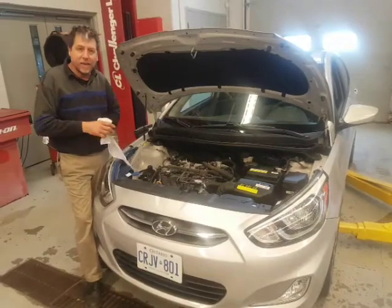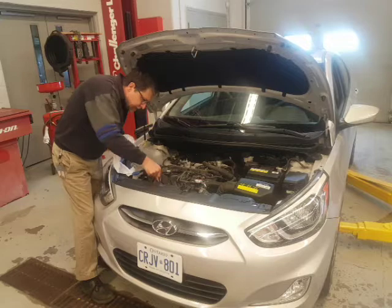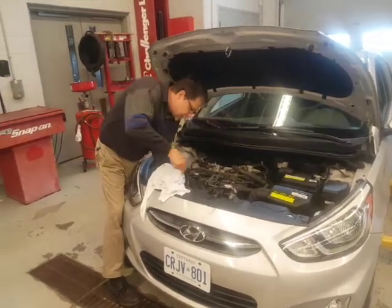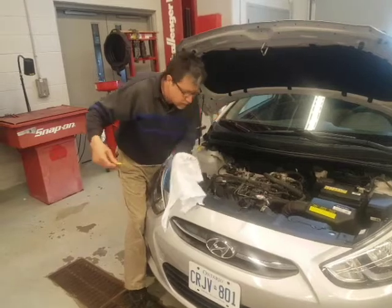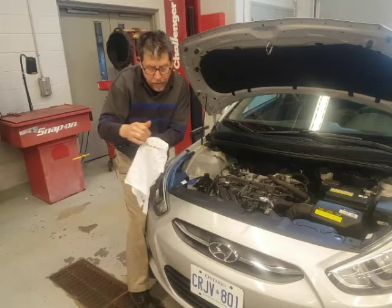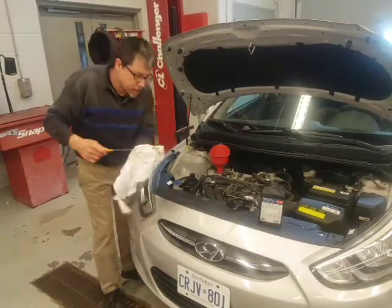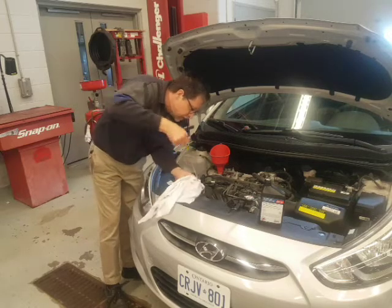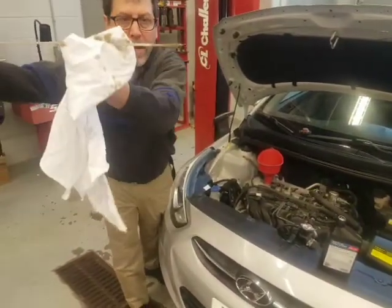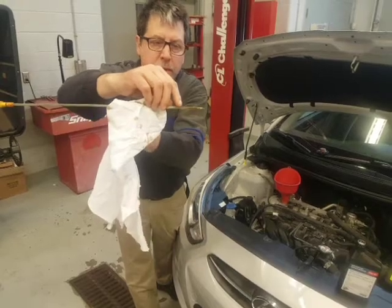You don't need to wait very long for the oil to drain back — gravity will make it go back in the pan fairly quickly. The oil will accumulate back in the pan. As long as the engine's not running, we can check it now. We're at about three quarters of the way up between low and full, so I'll add maybe a quarter of the can and recheck. I've added a little bit of oil. Make sure the dipstick is all the way in, pull it out, and read it. It is right on the full mark — if you can't see it on one side, flip it over. We're exactly at F, the top dot. We are full.